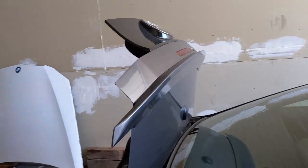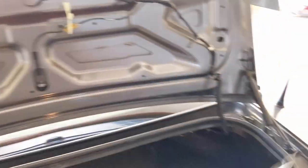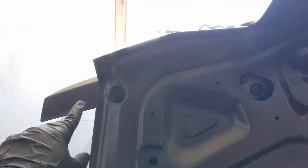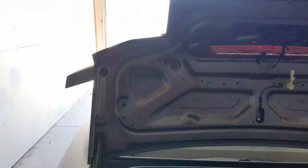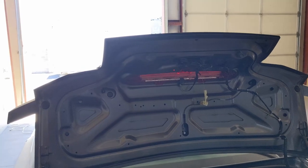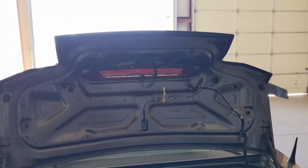So I'm going to remove the wing in the back, or spoiler, whatever you want to call it. To do this is pretty easy — you just got to remove all these little clips. I've already done that. There's like 13 of them, I think. Take the little panel off, and then there's four screws: one under there and then two in the middle. And then once you take that off, there's some sticky 3M tape that holds it on. You got to kind of separate it, but hopefully it's warm outside and it should come off fairly easy.